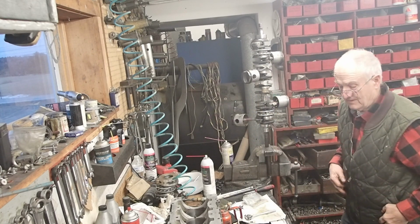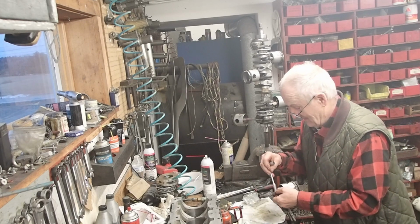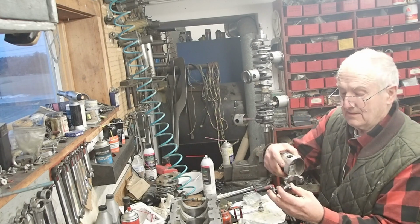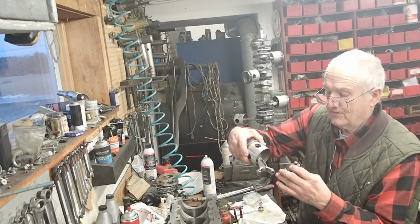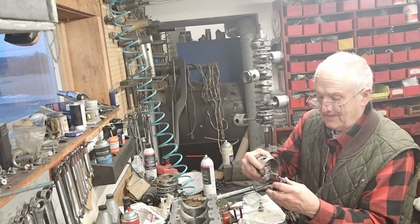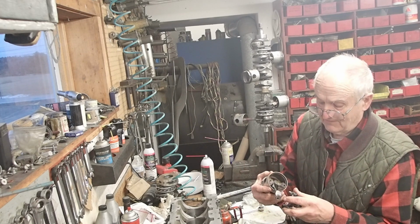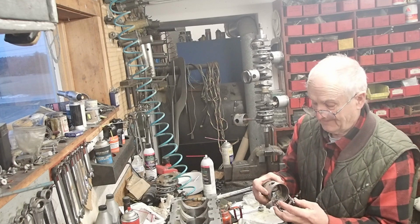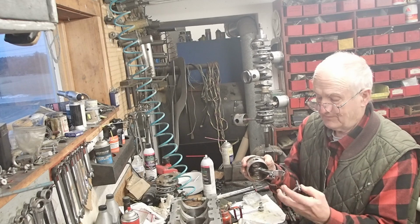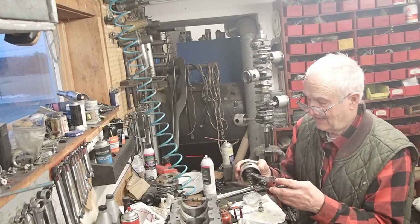Yep, we're in there. Next thing is with the piston, there's marks right here and right here. You want to make sure they're aligned. On some of the older engines, they had lines on the side, on the boss right here, etched lines. In fact, I think these do too, actually. But you line up these knobs, and these are matched. You can't interchange these end caps.